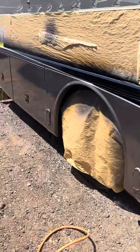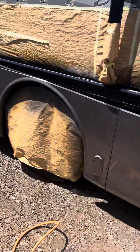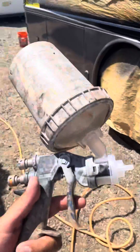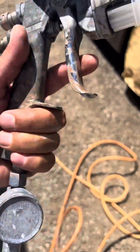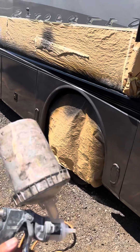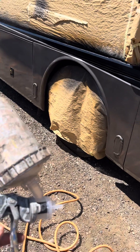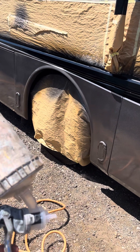So many people are interested in my video about how do you spray outside, how do you leave it so clean, how come you don't get dust on the vehicle. I told them there's a couple other things I have to mention, so I'll go over it again. First of all, my pressure is set at 20 PSI. I do go a little higher sometimes, maybe lower when I first start.